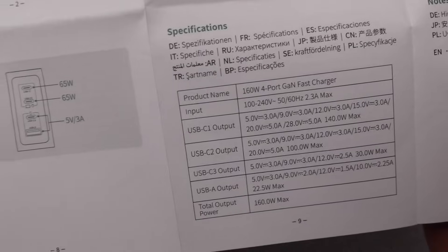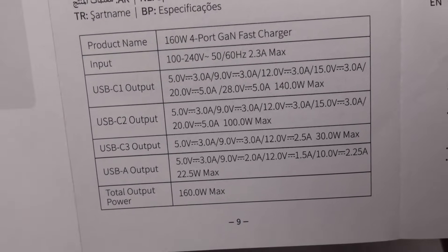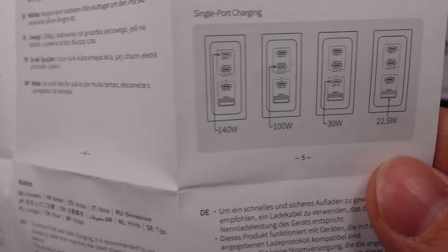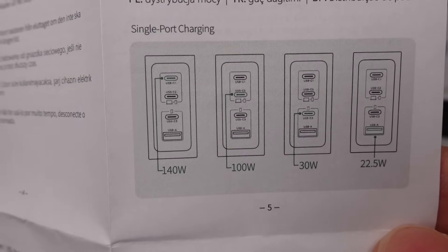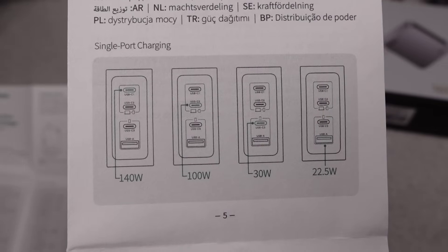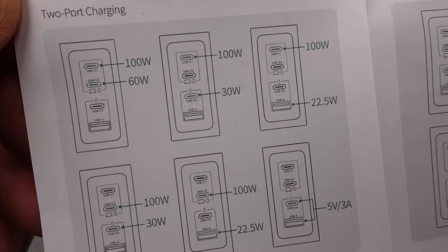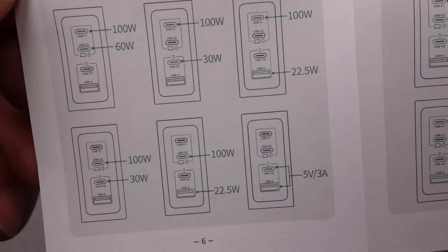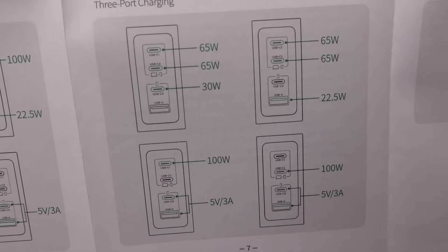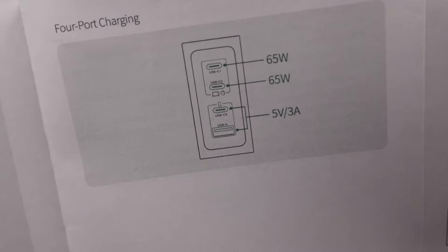The user manual for this charger is okay, but it does lack some critical information. I'm surprised they were able to sell this, as it lacks typically required information like operating temperature range or ambient air conditions. Again, professional product — I want to know if this is going to work in tougher environments. What I really like in the user manual are the infographics that simply tell you what it can do on each port with different USB devices plugged in. Some people were looking for even power sharing — it doesn't do that.